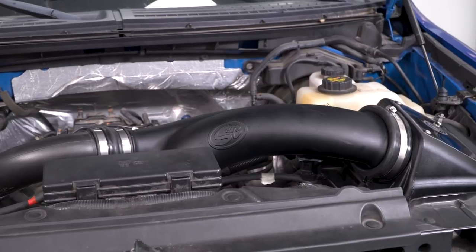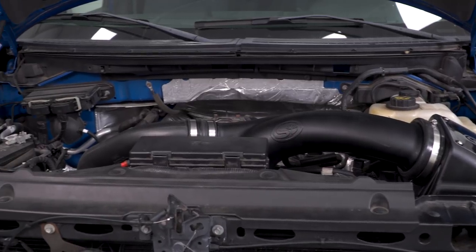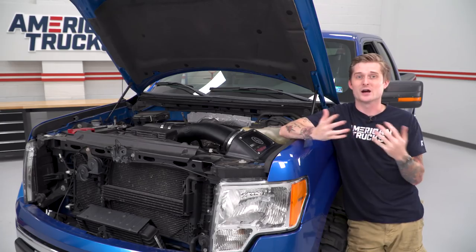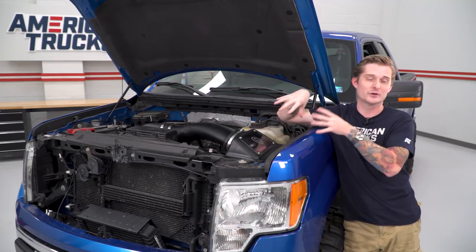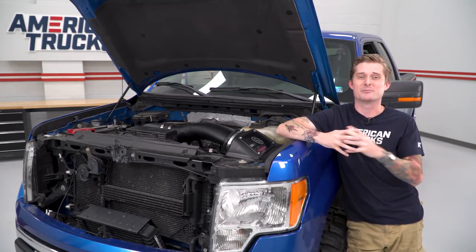As far as filters go, you have dry filters and oiled cleanable filters like this one. Oiled filters will move more airflow and more CFMs, providing more air to the motor. Thanks to the EcoBoost's ability to map things on the fly, you should get more performance compared to a dry filter. A dry filter is nice for off-road use — you can blow it out with compressed air and throw it back in. The oiled filter requires washing with basic detergent and water, re-oiling, and reinstalling. However, because a closed-element design insulates so well, it stays clean for quite a while — probably only needing cleaning every other oil change or so.